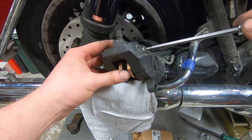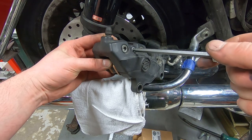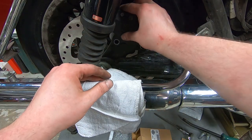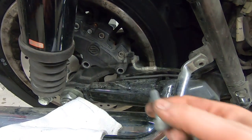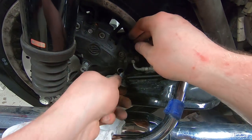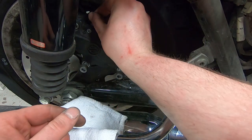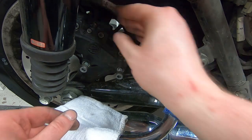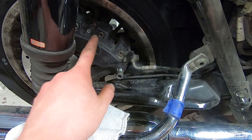we're going to get our caliper brake pad pin started, thread it in. And then put the caliper on. Bingo, bango. Get our bolts in it. At this point, I like to put the little safety clip in, the anti-back-out clip deal. Then I'm going to come back and torque these bolts and torque that bolt.